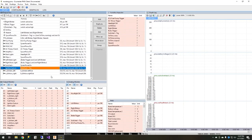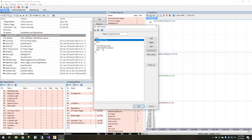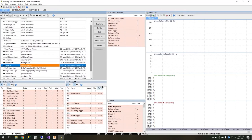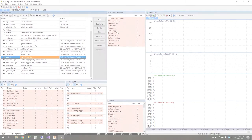When I turn the ignition off, I'm going to trigger the timer, so the timer starts running. The second half of my logical function statement says: if the timer is running or has completed, don't do these things. The reason for that is I want to turn the key off and have everything in the car shut off as I get out, but the PMU is still alive — so if I turn the key back on, everything springs right back to life. The benefit is that because the PMU is still alive and the timer is active, when I open the door to get out of the car, it will not re-engage for the first time and prime the fuel system. For all intents and purposes it looks as if the car is off when I get out, but the PMU stays engaged for a few more minutes until the relay timer expires and the whole system shuts off. At that point, everything is disengaged other than whatever's on constant power, so it won't drain the battery.